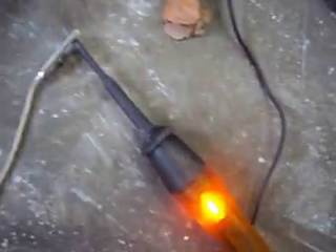83 milliamps is about enough to kill your battery after about three or four days of sitting around, especially if you've got cars on your lot. Typical cars don't get driven every day — they get driven once a week or so. When you go out there to start them, the battery's dead and then somebody's complaining.